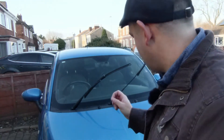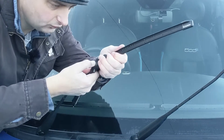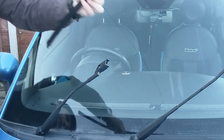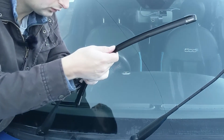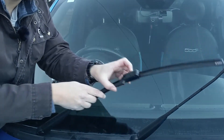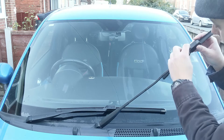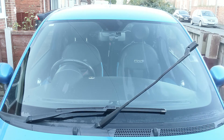So with that out of the way, what we'll do is unclip the wipers — it's just a simple push release mechanism — slide one blade off and then put a new one on in its place. Push and slide, and that's locked in, simple as. We'll do the same with the other one: release tab just there, press, slide the blade out — Bob's your uncle.